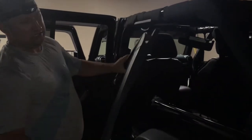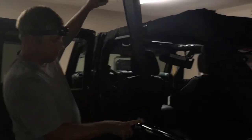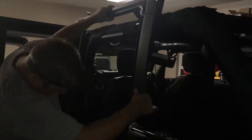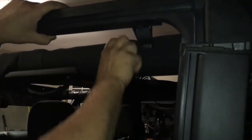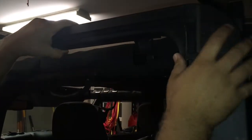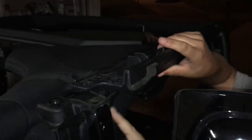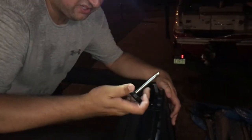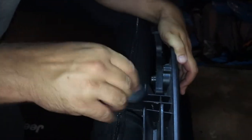We're going to unfold the piece. You've got this tab at the bottom and these holes where the hard top used to be — put that in there, right here. It slides into place. Up here at the top, you've got this U-shaped piece that's going to go around the bar and line it up to the long bolt that goes through there. When you get it up, this should be facing forward to the front. Make sure the gasket seal is up and over and into the channel, not pushing and binding it. Then try to get the long bolt pushed down through the hole — move your fabric back if needed — line it up and wiggle it around, then tighten into position.